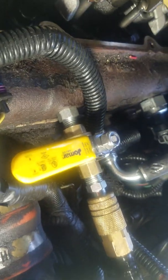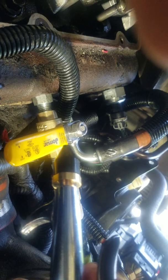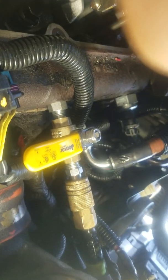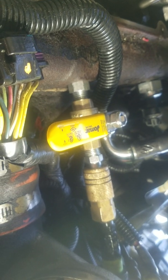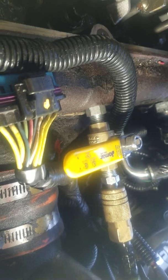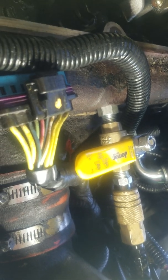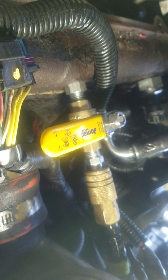Getting over to the driver's side — it looks complex, but it's way more complex than you'd actually need. You could just as easily use any air nozzle, such as this little one with a rubber tip, that you simply put into the head to get a decent seal. I've heard this is also known as a Cody test. I've heard 100 psi is essentially the benchmark, and that's what I have my shop set up at. Since I was by myself, I didn't have the luxury of having someone hold the air nozzle, so I ended up installing this valve with a kit I got online to test high pressure oil lines and also do an air test through the IPR.